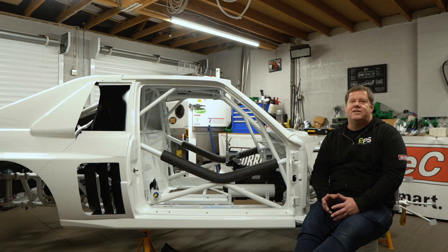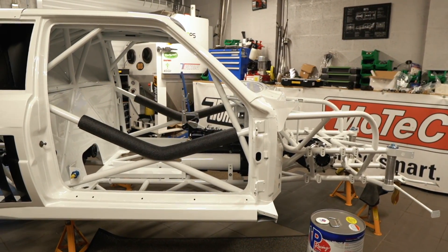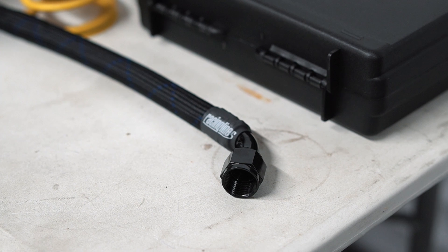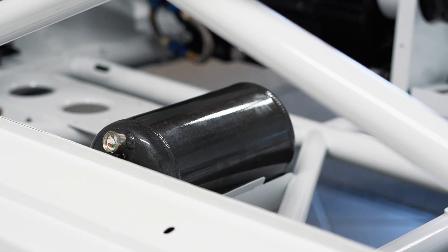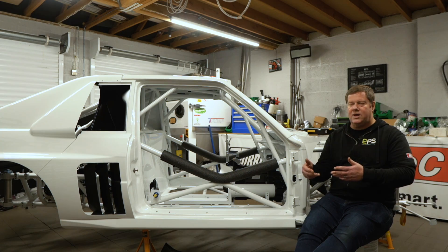One of the things we're also going to do is build the car from the inside outwards — all the hard parts like hoses and hard lines go in first. Trying to route hard lines over or under pipes and wiring is very complicated, and it really pays dividends to have all your plumbing correct and secured properly. You don't want pipes rubbing through on things or areas that are hard to access and clean on the chassis.